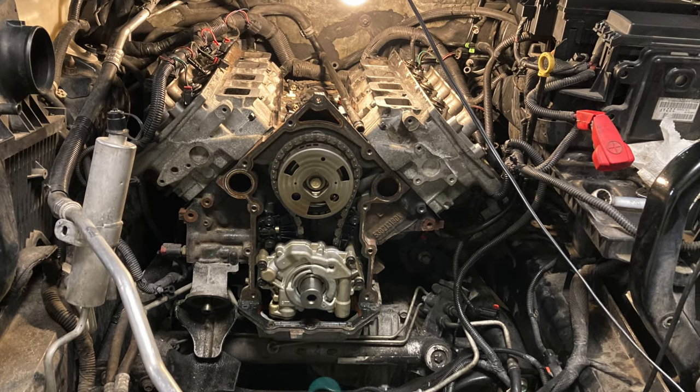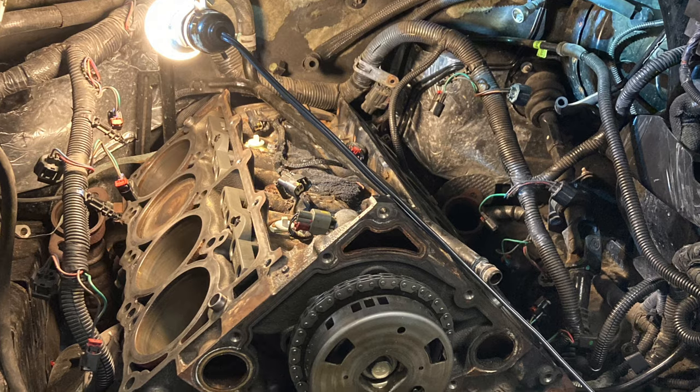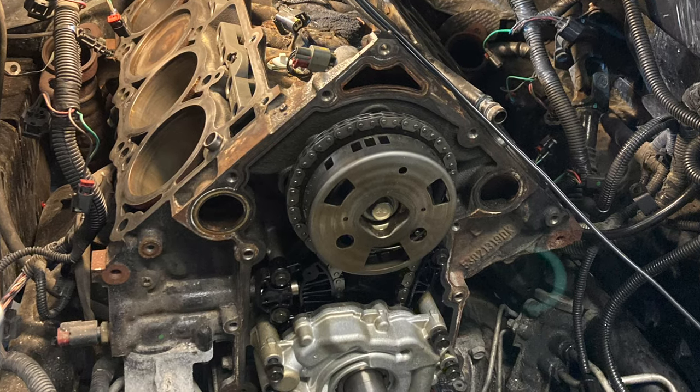So we get started with the project. Pull the radiator, pull everything off the front of the motor — you then have space to stand in there and get easier access to the intake, pull the intake off, pull the heads off, pull the cam out, and everything else on the front of the motor. You can make marks on the crank and cam sprocket for timing as a way to avoid pulling the oil pump off the bottom — but I wouldn't really advise that. You really should be pulling that oil pump off anyway and replacing it because there are oil and metal shavings going through the motor. That does require lifting the motor and dropping the oil pan to access the pump.